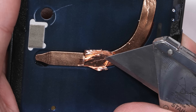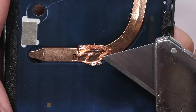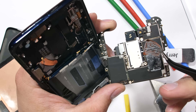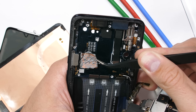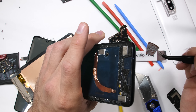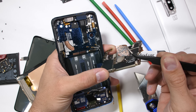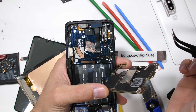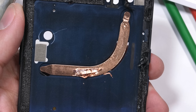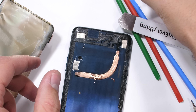So now we've found the heat pipe, but OnePlus has been calling this a 10-layer liquid cooling system. Even if we count the metal over the processor, the thermal paste, the weird copper square, and the heat pipe, that's only 4 layers. We could try to include the internal vapor, copper wick, and other side of the heat pipe, which brings us to 7. Maybe toss in the aluminum frame of the phone, which takes us to 8 layers. But from my perspective, this '10 layer' verbiage sounds like marketing jargon. Keep in mind that manufacturers don't hand out hardware repair guides with their phones, so I kind of just call it how I see it — and maybe I'm missing something. What do you think?